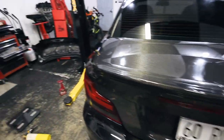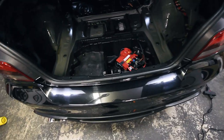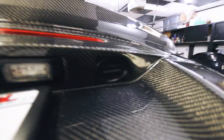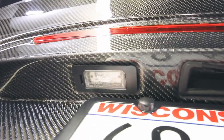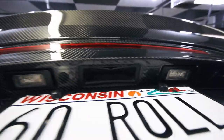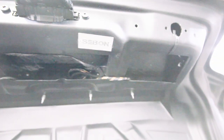As you guys can tell, I'm sweating. This trunk has really made me put some elbow grease in to get it to fit and latch, and to get everything transferred over. As you can see, it pops open just like it should. I've got the license plate lights in, the handle. I couldn't get the lock in, so you'll see I just have some electrical tape right there covering the lock hole — not too worried about that. These did require me to shave down the license plate lights to get them in. I used a file and kind of shaved them until they both fit in. The handle doesn't fit perfectly in there, but it's in there and it works. The third brake light is in — that was pretty easy with just the four bolts there. I got the harness tucked all up in there, but it wasn't the most fun thing. I would say the hood was definitely easier.